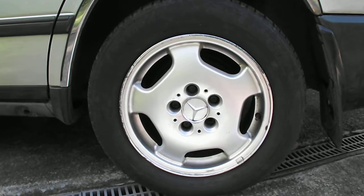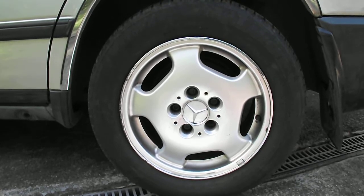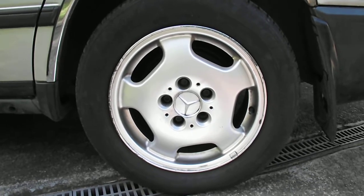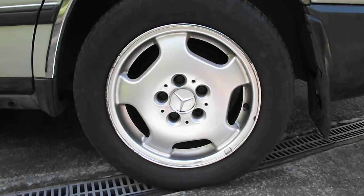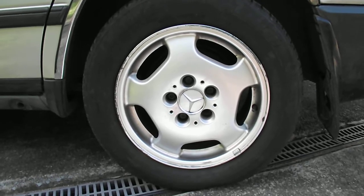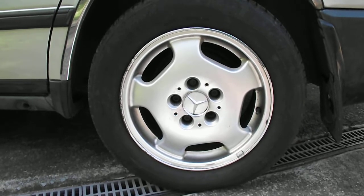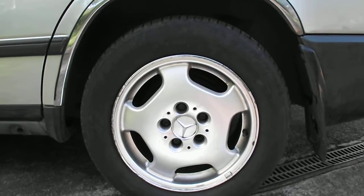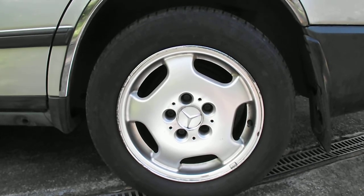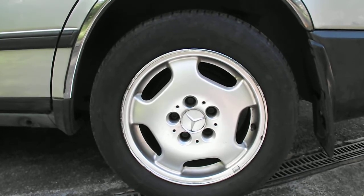My brother bought this car and I'm looking after it for a few days, and when it was delivered, by just luck really, I happened to be standing at the front of the house, and I could hear this ticking noise or bumping as it came out. It was a regular noise, and I realised that it was happening once every rotation of the rear left-hand side, which here in Australia is the passenger side, wheel. And so when I had the opportunity, I looked it up and I found that there is quite an issue with the length of the lug bolts.